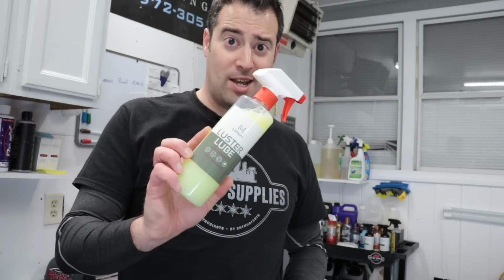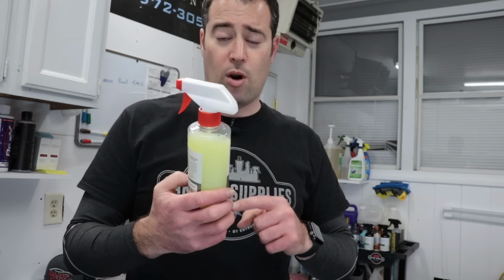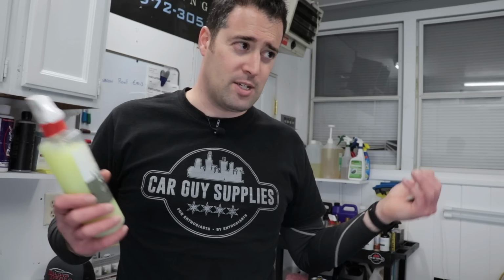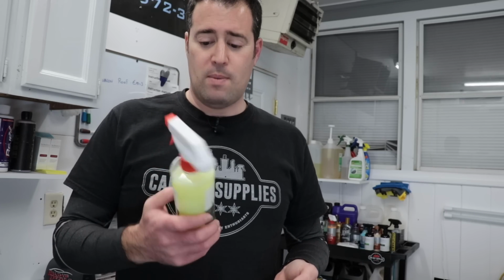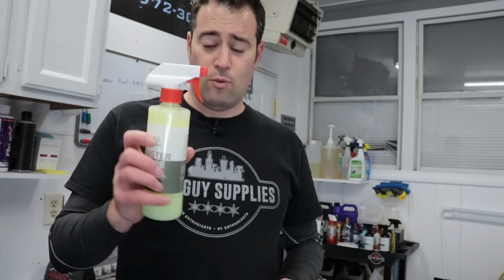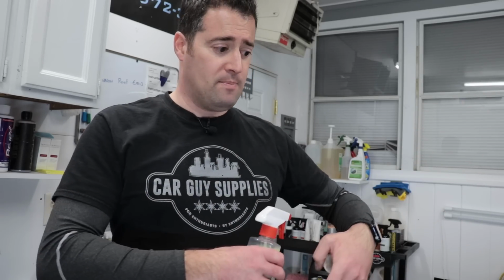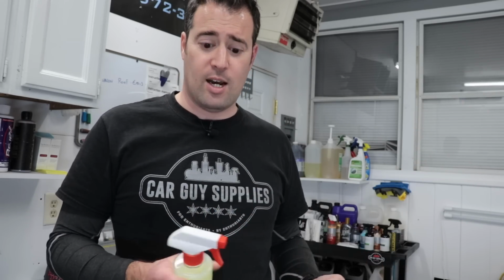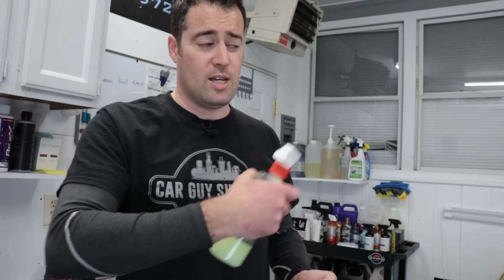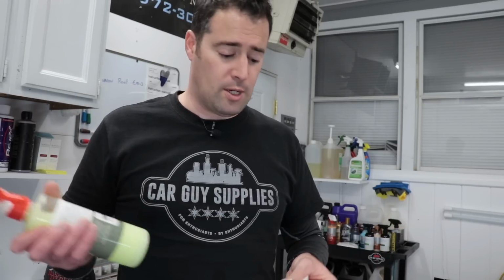Excellent guys, thank you. And again, this stuff, really, really nice. I probably could have even cut it one-to-one or even more with water to use as a clay lube. I know some people may say that. So maybe you don't want to use it straight, because you can definitely water this down or do it on a wet car that's already been washed and rinsed and the water's hanging on, and you can spray this on and use the water already on the panel to dilute this. I do that too with a lot of different clay bar lubes, so not a problem.